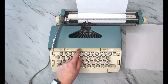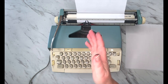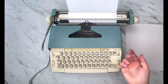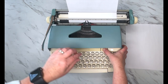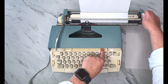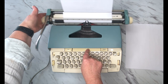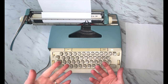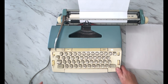Now back to your tabs — I showed you how to set it and how to clear. If you want to clear one tab, you can just hit clear and it'll tab over. But if you want to clear all your tabs, you just hold clear down, release the carriage while holding the clear tab down, and that should clear all your tabs. And so all the tabs are now clear. I am getting ink all over this typewriter so I will have to clean it when I'm done — but that's just part of using a typewriter.